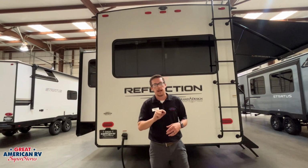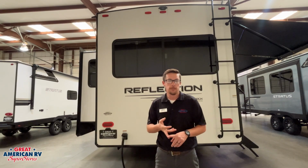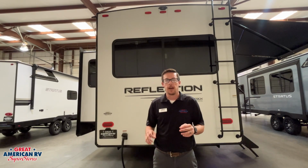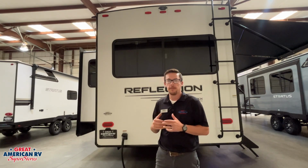every 60 to 90 days. Every 60 to 90 days, check the sealant, looking for decay, looking for peeling, looking for cracking, looking for ability for water to make entry into your unit, and we don't want that to happen. Manufacturers require in your owner's manual to check that sealant every 60 to 90 days. If we don't, you're going to have issues with your camper.